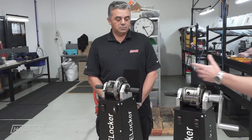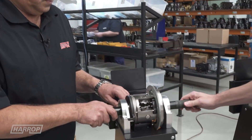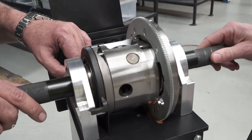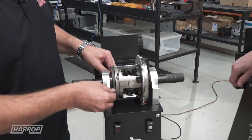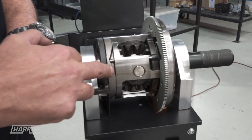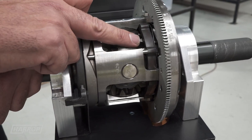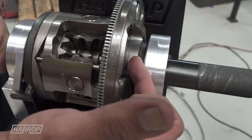We've got two of our display stands here. One of them is the common one that we use a windscreen wiper motor to make it dynamic and for it to turn. Quite simply, we've got a 12-volt electromagnet here which activates a load plate, which pushes the pins up against the lock-up plate, which engages the gear to the housing, and we've got a spring back here which returns.